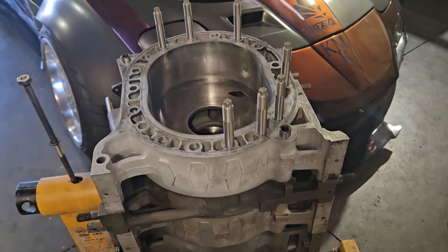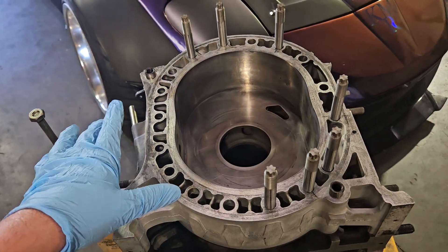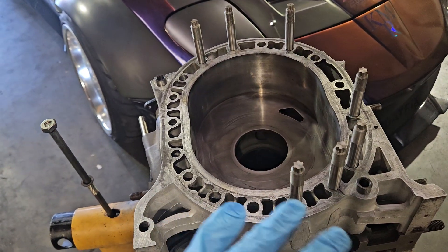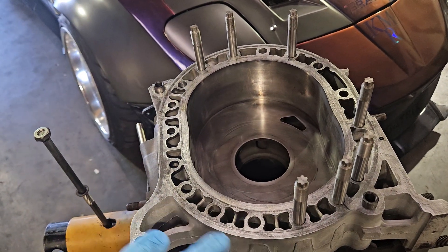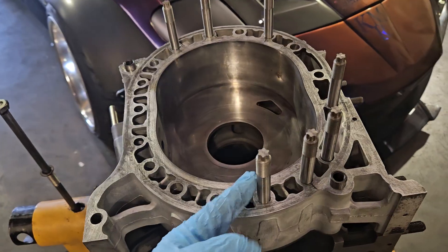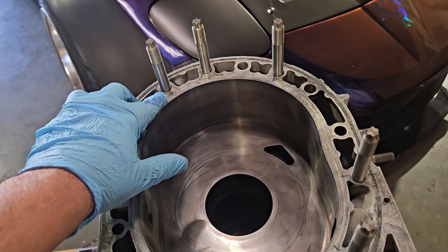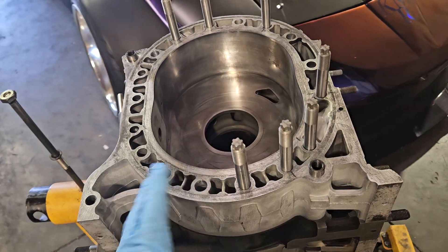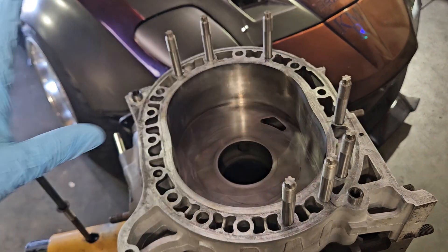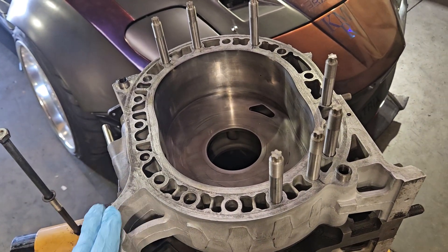With my personal three-rotor and 20B blocks, I'm pushing a lot of boost, a lot of abuse, a lot of horsepower. You've probably seen previously on my channel where I'll have a completely studded 20B block. We often do the entire studding on 13Bs — replacing the OEM tension bolts with half-inch precision machined hardened steel studs. We do a precision machining process on the block so the fitment is precise, with a little bit of tolerance because the block is going to expand with heat. When done correctly, this strengthens the block massively, but it's expensive, it's time-consuming, and not everybody is trying to run 30 to 40 pounds of boost.